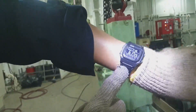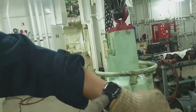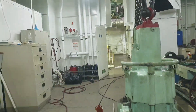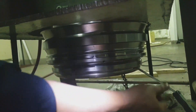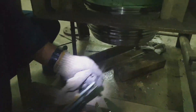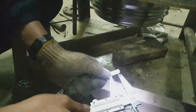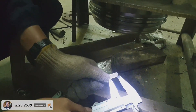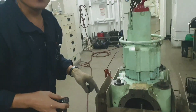The exhaust valve should be kept at least 15 minutes in the closed position. If not, there is some problem with the assembling or with the piston sealing. As you can see, the clearance of the valve seat and the spindle is one millimeter, and the dip of penetration is 15 millimeters - that is the clearance of the exhaust valve spindle against the exhaust valve seat. It is now past 15 minutes and the valve is still in the closed position.